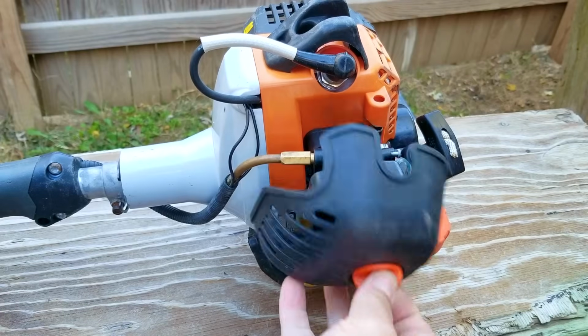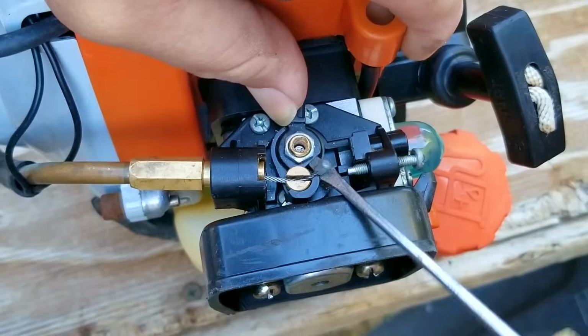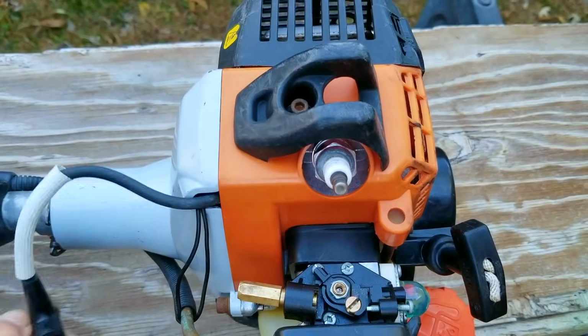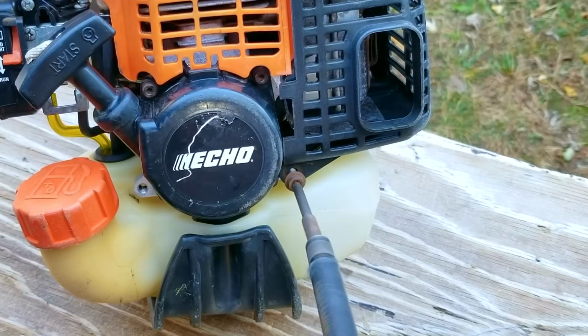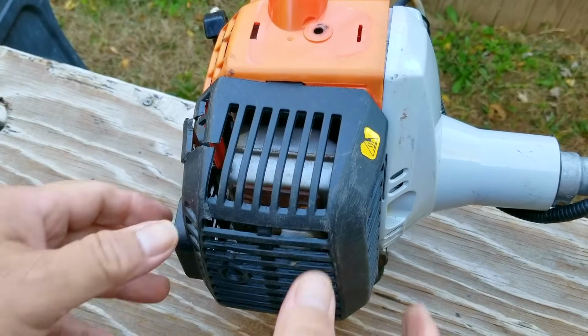But with how it's acting when you try and start it, you would think that it was worn out when in fact it's not. What that means is the problem is not with the fuel system as far as I can tell, or the compression, and since it's trying to start, the ignition system looks good too. The only thing I could come up with was a spark timing issue, meaning we have spark but it's happening when it's not supposed to.